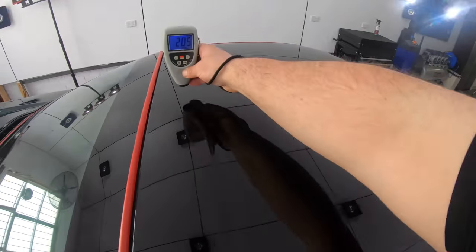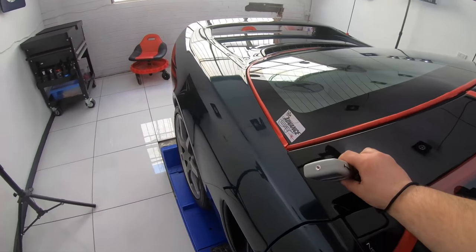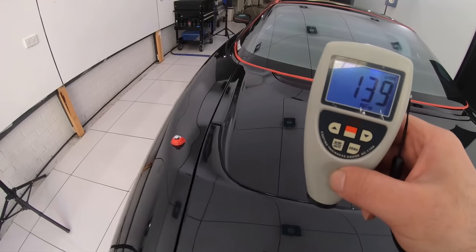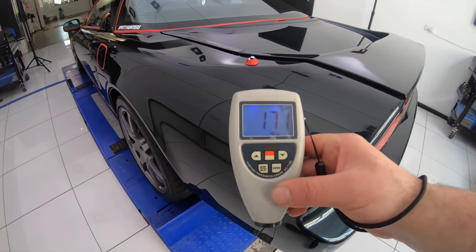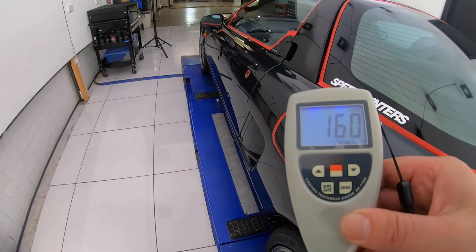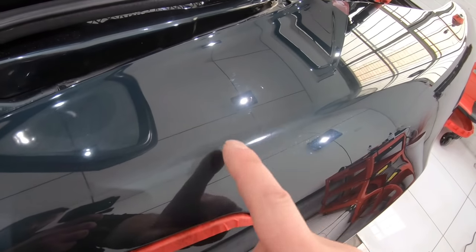And as you'll see, once we get to testing and polishing the paint, I was able to confirm that the paint on the bonnet and side panels actually was identical, not only in look, but also in hardness and sensitivity. However, after a closer inspection, I did discover that the rear bumper and rear left quarter panel had in fact been repainted in the past, also having a minor burn mark where you could see the original paint beneath. As was the case with the black roof, that although there were half decent resprays, they just weren't to the same level of the rest of the OEM paint, that I have to say was perhaps one of the best I've seen from any car manufacturer.